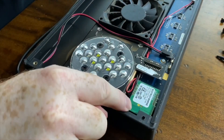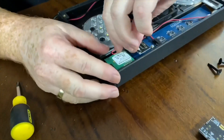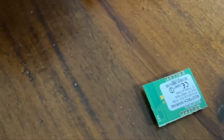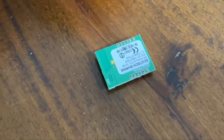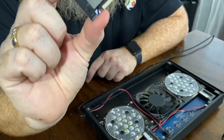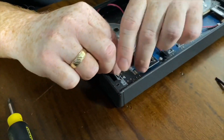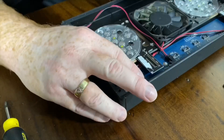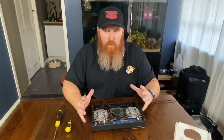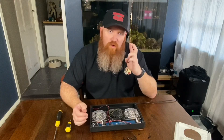We remove the plate itself. My guess is this one here, because it's the only one that looks even remotely similar. Just going to gently pull it out like that. So that's the Ecotech Marine RF module. We're replacing it with the new Mobius chip, which is the Bluetooth transmitter. It just goes back into exactly the same spot, all nice and secure. That's all we need to do. Now we're going to put it all back together, plug it in, and fingers crossed it works.